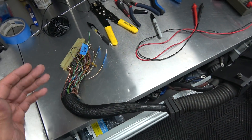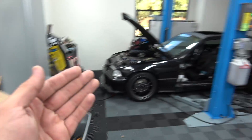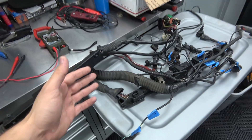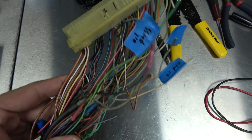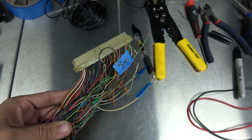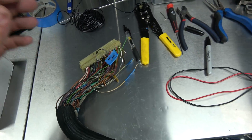This is what I've been working on for the past few days. This is the engine harness for my E36 drift car. This will be an M50 Vanos harness. I've been repinning the whole harness, changing ground shield wires, different signals and stuff, so I can make it work with my brand new engine management system provided by ECU Master USA.